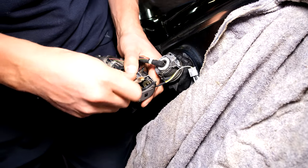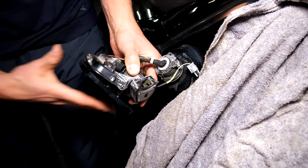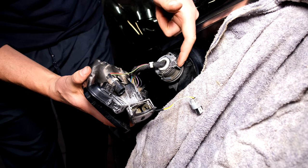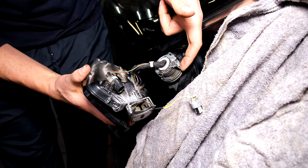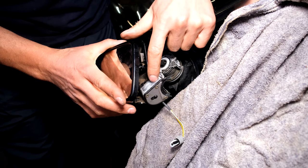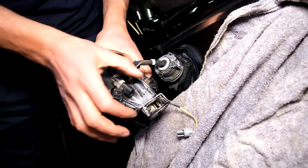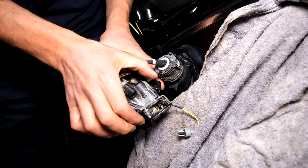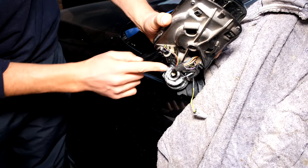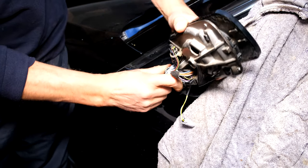I'm buffing these surfaces to make them rough. The first step is to use superglue — I'm going to put superglue on all the tears, so it'll be there, there, and there. I'm going to make sure that no superglue goes in there otherwise it won't turn nicely. I've removed most of the paintwork and roughened it up. These scratches and gouges are actually helpful for the epoxy — it's going to bond onto the aluminium but also create a mechanical bond because I'm going to put the epoxy in such a way that it acts as a clamp. I'm just checking that it will seal nicely, nothing is in the way, and that it does move — yes it will move perfectly well.